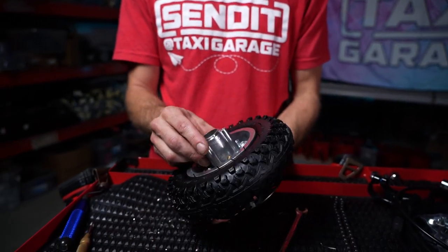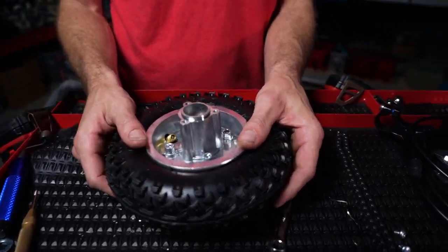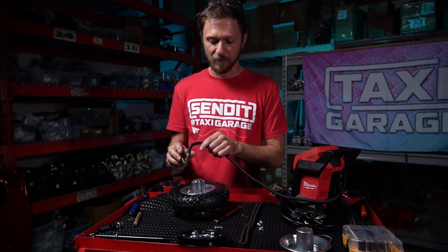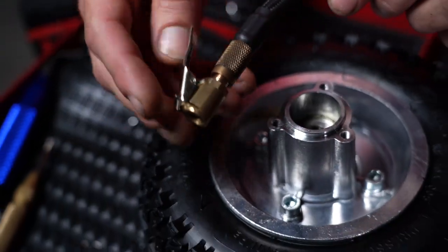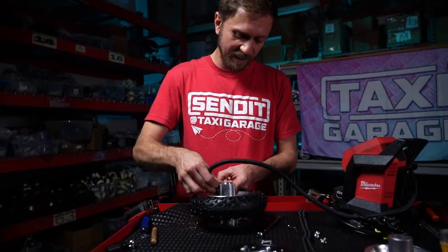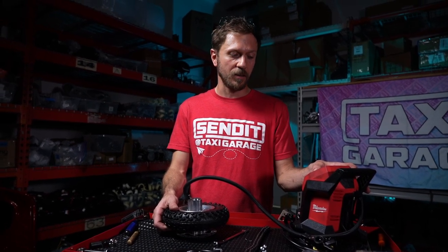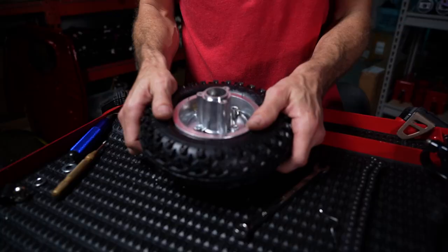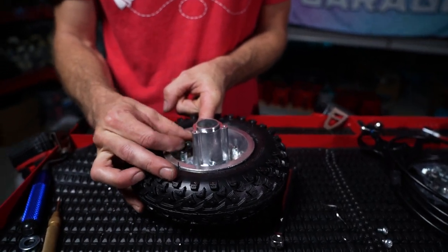Once tight, pick it up, slide the axle bolt out, and set it aside — confirming that when installed everything was aligned. Before putting the gear on, fill the tire with air so you don't have to take it back apart later. Use a quick-change air tool from Amazon for much faster filling. Set knobby tires to about 45–60 PSI. Once filled, put a cap on the valve stem.